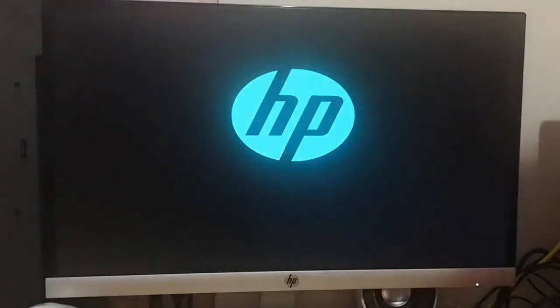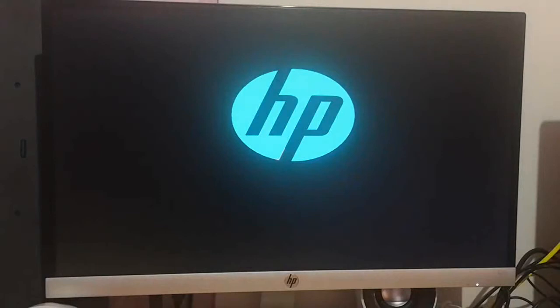Sometimes it happens that it will start again from that Windows installation window. So it is better to remove the pen drive once it restarts the machine.